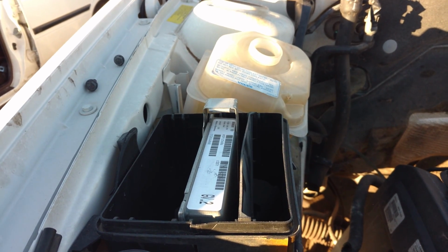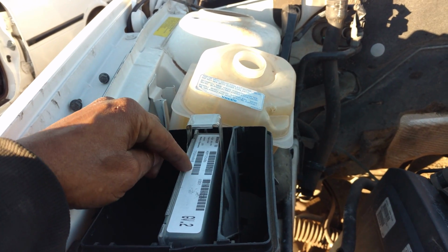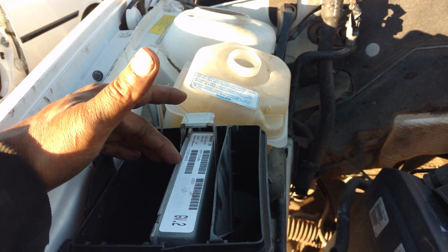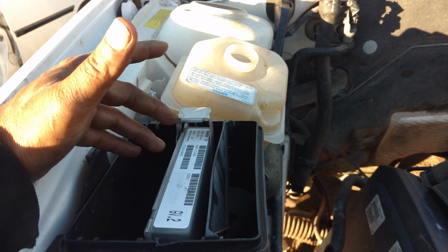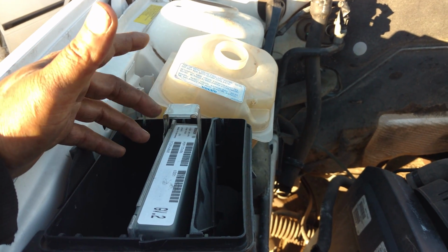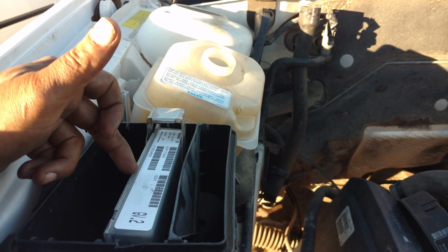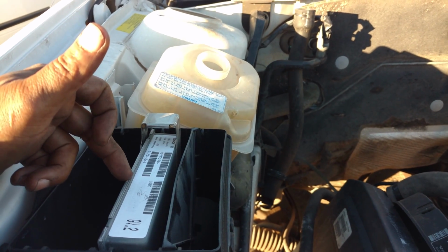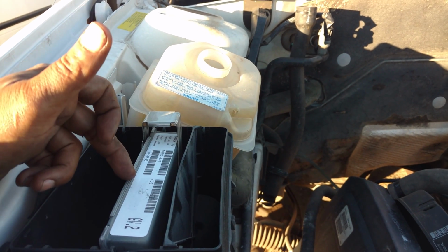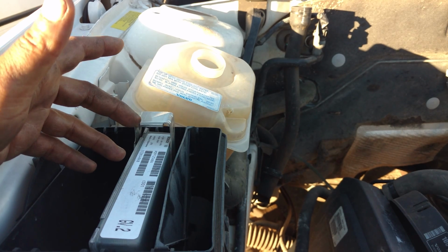I would also recommend that you get a turbo T5 ECM computer, preferably one that matches your car, '94, '95, '96, or '97, something that matches your car's emissions so that you don't have an emissions problem. That computer will have to be reprogrammed, or flashed, so that it's not looking for an automatic transmission. I would prefer to use a spare.